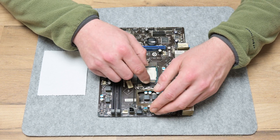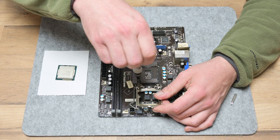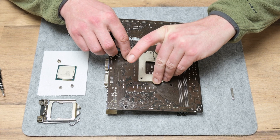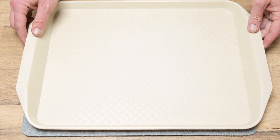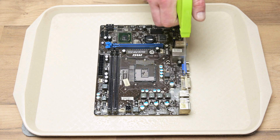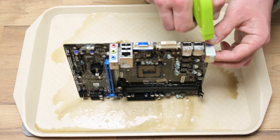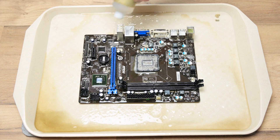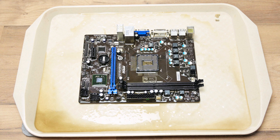Now I remove the CPU and carefully remove the CPU bracket — the metal door that holds the CPU in the socket. I place a serving plate with the motherboard on it and spray degreaser mixed with isopropyl alcohol all over the motherboard. This degreaser is nothing special — it's the same degreaser used to clean the kitchen or other oily parts. After spraying, I leave the motherboard for about 10 to 15 minutes until all the dust and dirt is dissolved.